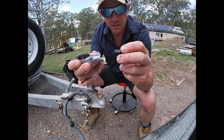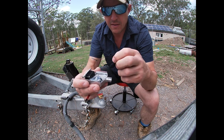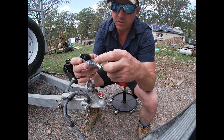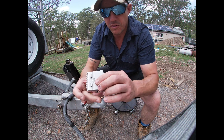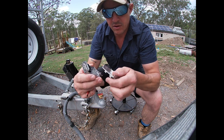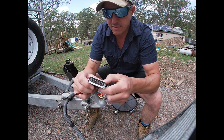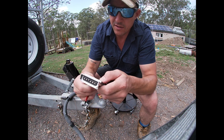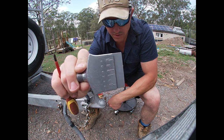We've got the gland that needs to go on first, then the locking nut, and then the cable securing clamp so the cable isn't pulling on the actual fittings. Then those two little pins. I'm hoping this will be stronger — it seems like it would be. We've got the seven pins: one and four are right and left indicator, stop, service brake, auxiliary, tail.